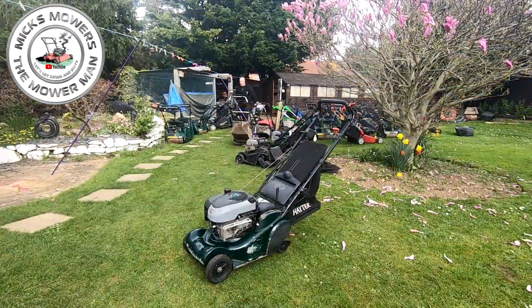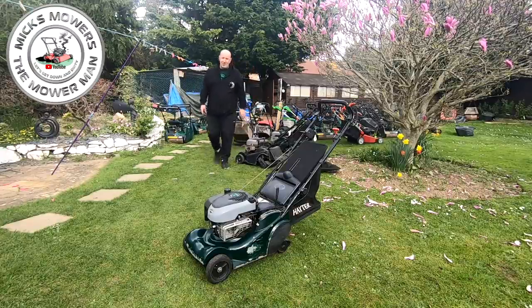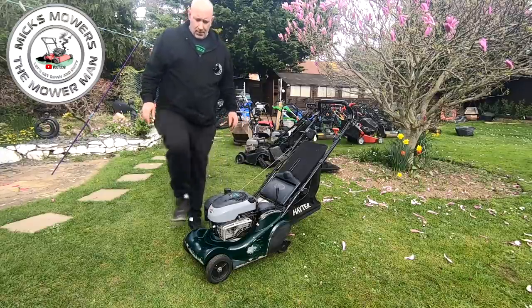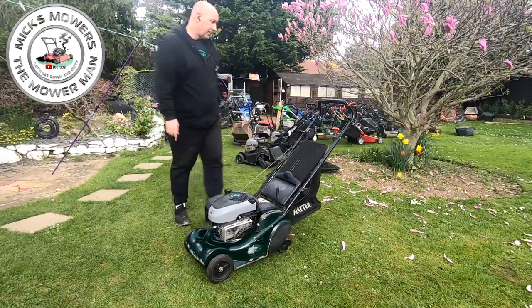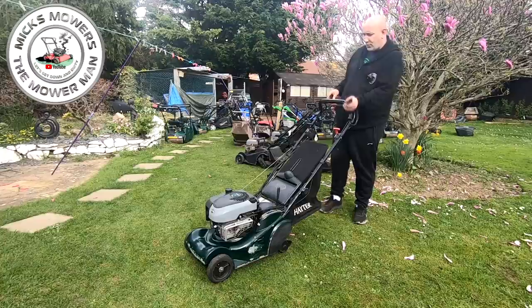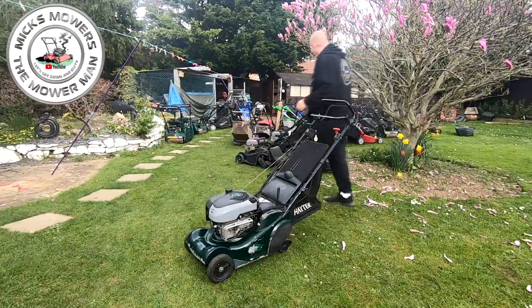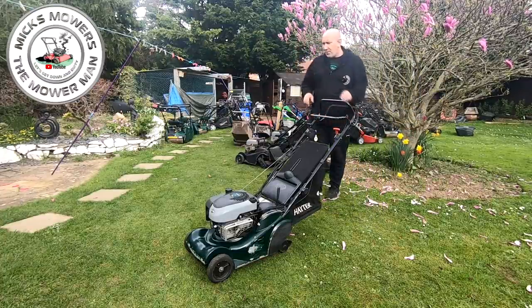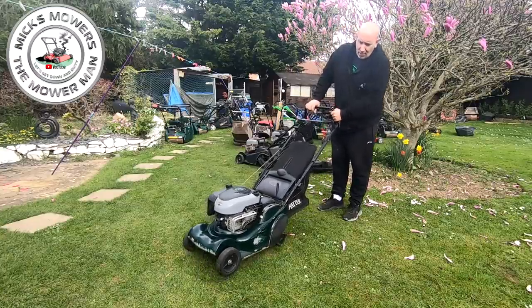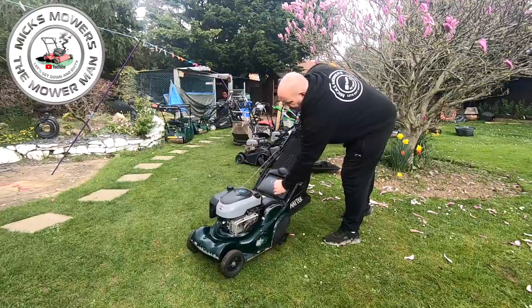Okay, so moment of truth time. Have we fixed it or not? Now, do you remember, on this one here, suspension, yeah? On this one, solid. So we have now fixed that bit, okay? But I want to make sure that the drive now works. I don't know if the drive was working, to be fair, to begin with. Maybe the gearbox is gone, but we should see. But there's now no suspension dip on that, and the height control now fully works as it should do, okay?